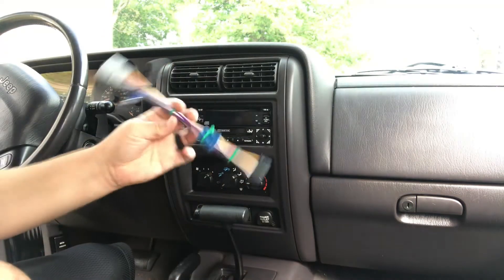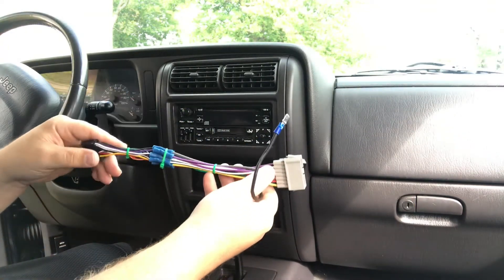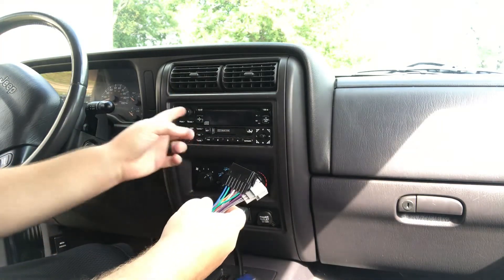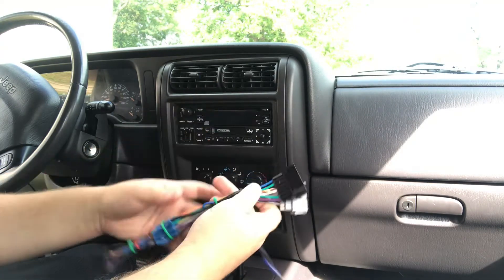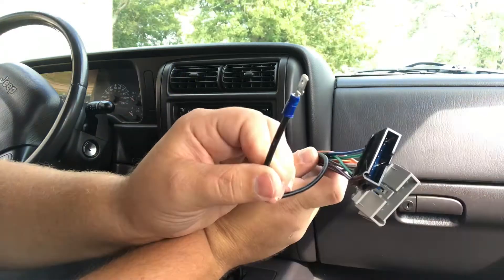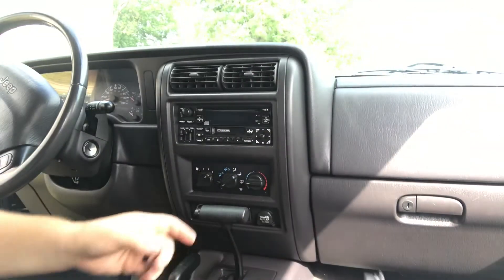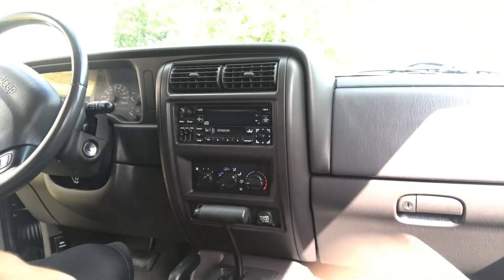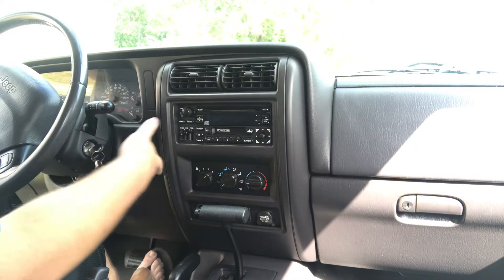I've already made up the wiring harness. The wiring harness is straightforward. The only thing that's different is on the back of the factory stereo there's a prong they use for the ground — there's not going to be a ground on the aftermarket plugs, so you have to have a male connection for the ground. I've already put the stereo together; it's just a standard Pioneer stereo.